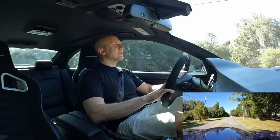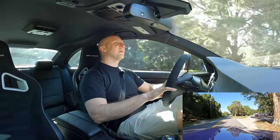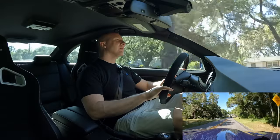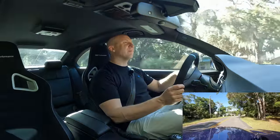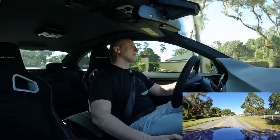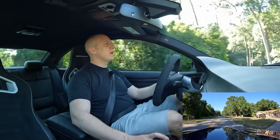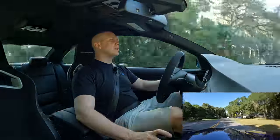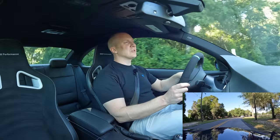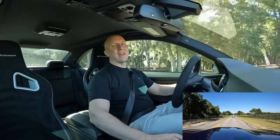Right now I have BBS FIRs. I'm breaking my own rule, which is to always lower before we put wheels on. I just wanted to get everything cleaned up. I threw these wheels on and I had a leaky tire, so I had to replace the TPMS. It's really nice having your own tire machine - just go in and fix that. I have PS4S's 265/30/19 in the front and 295/30/19 in the rear. So a 30 millimeter stagger, which feels good on the car - a little more grip in the front, a lot more grip in the rear.